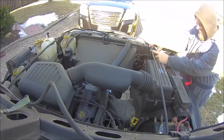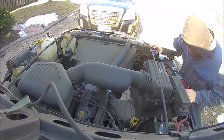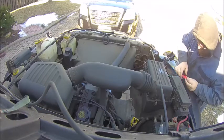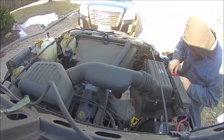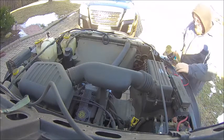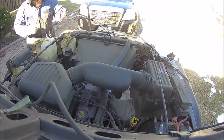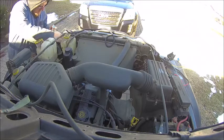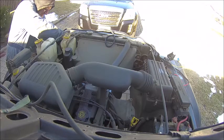And I actually have an auxiliary fuse panel right about where I'm looking right now. I had 3 unused circuits on it, so I'm thinking that maybe I would just cut off the inline fuse holder and connect it directly to the fuse panel. I did try later on in the video to connect it to the battery, but I ended up cutting that part out because it wouldn't fit over my existing accessory post. I figured I've already got the harness, so I might as well make use of it.